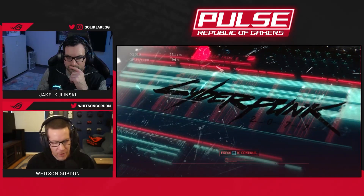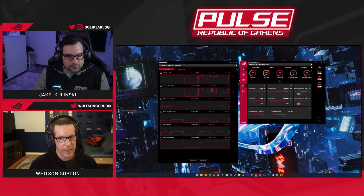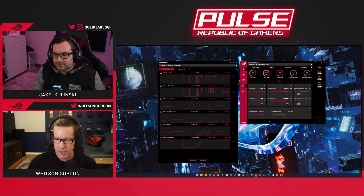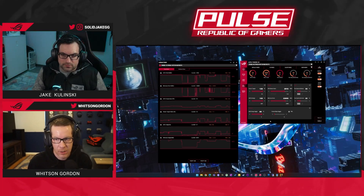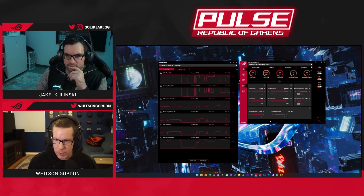Once you start doing memory overclocking it becomes a little more work. If you just want to do the GPU boost clock, spend a couple of hours and then you're done — it's free performance. Put in a little more time to dial in a memory clock and you'll get a little bit more out of that. I actually noticed more of a boost from overclocking the memory than usual with the 4070 Ti, so I do think it's worth checking out. For VRAM testing, OCCT has a VRAM test, but that's not really going to tell you whether your memory overclock is stable — it only detects bad chips, not whether you've overclocked too far.